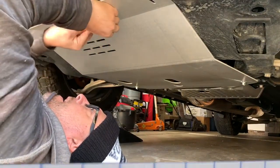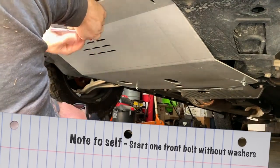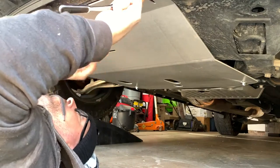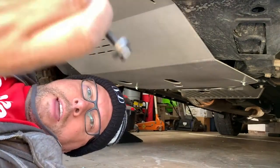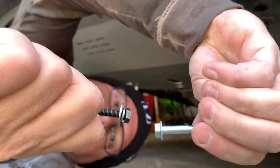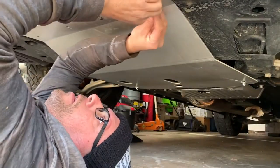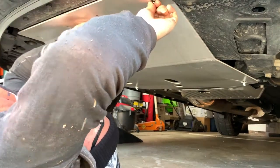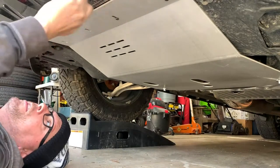What I noticed is I have to take the washers and lock washer off and adjust it a bit because there's some metal behind here — you've got to pull it forward almost to the end, line it up, then get one bolt in there. They've given you this upgraded bolt — the originals were having problems popping out. When I first tried it, it was very difficult to get started, so I recommend doing one without the washers first just to get it up there and compressed against the plastic, then this one went in fine.